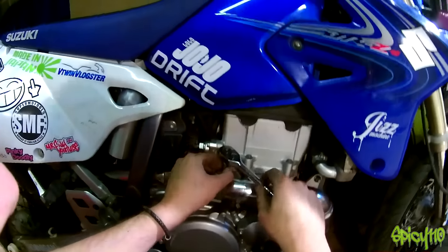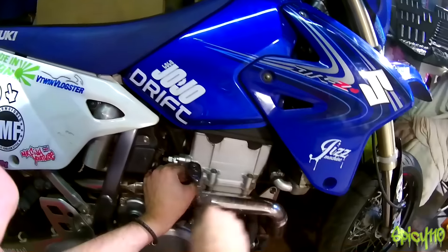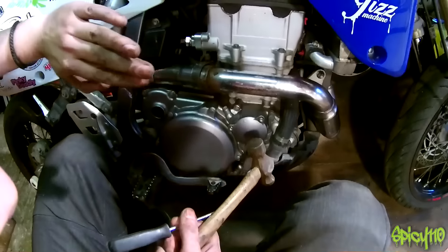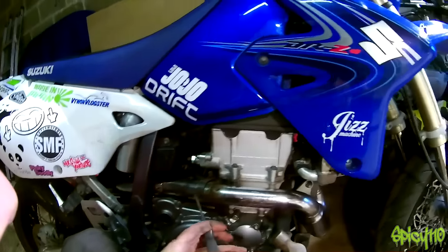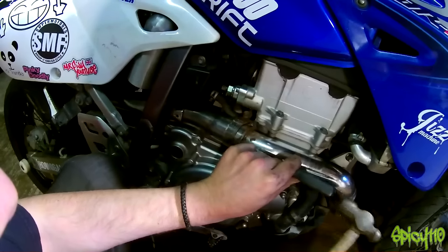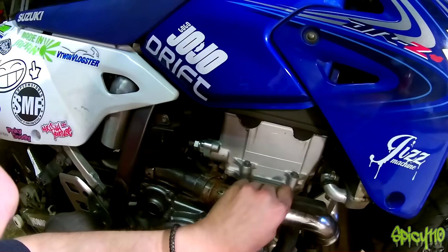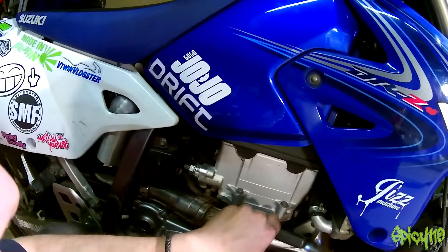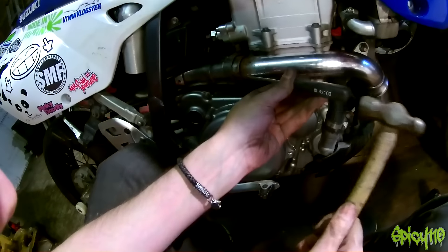The bandage is crammed down in there — make sure the clamp is nowhere near the engine so if it does vibrate a bit it's not going to be smacking into the side of the engine. What I've ended up doing is using a piece of the metal that was in there before, just one wrap, which I've then started the bandage on, then put the metal over it and twisted it and then put bandage over the top. It's a bit like caulking on a boat — I'm tamping more of that bandage down in there and this is tightening the fit up no end. Then I'll clamp it and when it gets run it will set. It's certainly not the slickest way, but it's going to work for me.